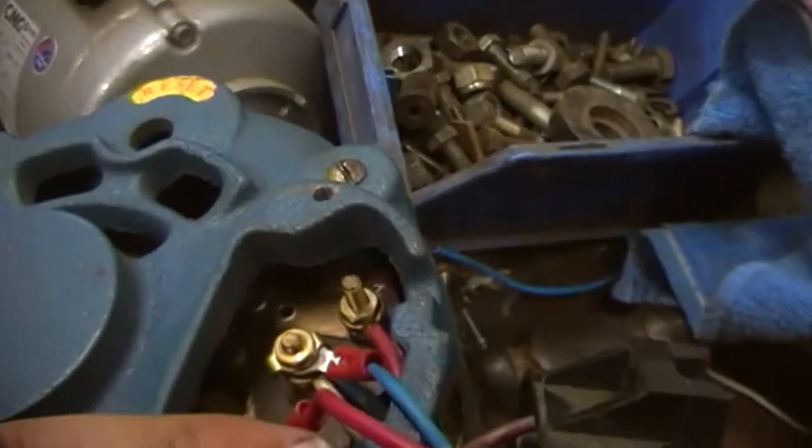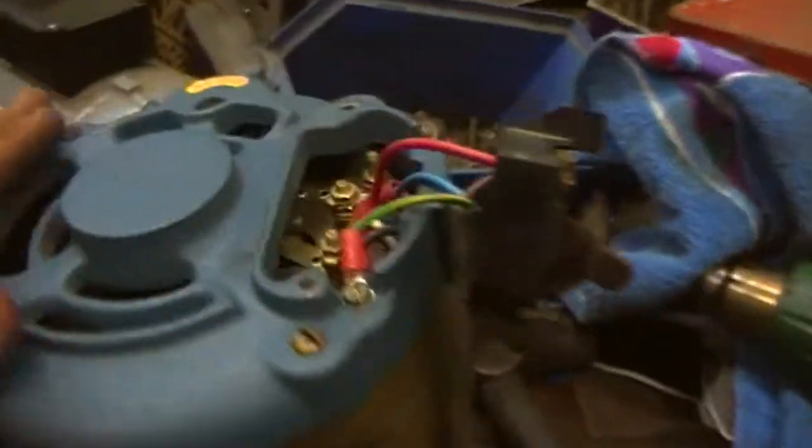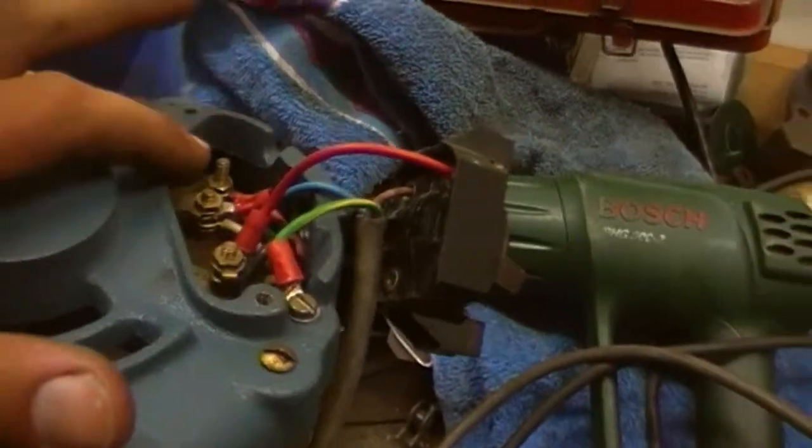Wired in the switch. When I got it, it was wired on the neutral — switched on the neutral, which is a big no-no. Anyway, it should work fine now. Just wire it in, fit it all back, tighten the nuts up, and I'll give it a test run for the camera.